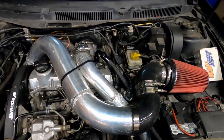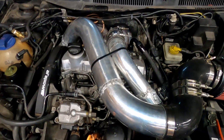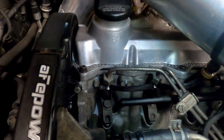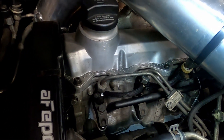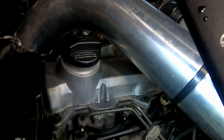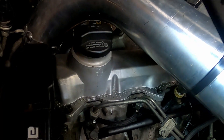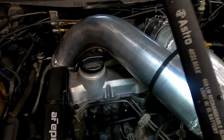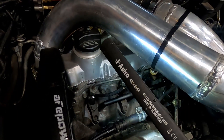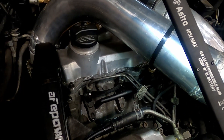It has CJA rods — the strongest rods available from factory in a TDI that I've found — and they work with the PD-150 parts perfectly. The head I bought secondhand from the UK; I believe it's an NPS CNC-ported head. It currently has an NPS cam — a pretty mild cam — but it works very well. I am putting a larger cam in when I have time. It does have ARP head studs, but the bottom-end bolts are all reused — probably shouldn't have, but I did.